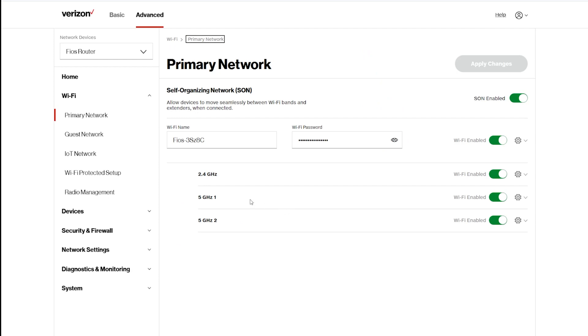And I made a terrible mistake. I moved our cameras over to that network as well, and they all but stopped working. They wouldn't load; you couldn't see any live view. I think Verizon throttles this network because switches and plugs don't really need speed, but cameras do. So I moved the cameras back to the primary network, which has band steering — a mix between the 5 gigahertz and 2.4 gigahertz bands where the router decides which band your device connects to. After this, the router was cleaned up, but I still had my Wi-Fi issues.